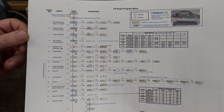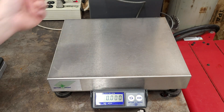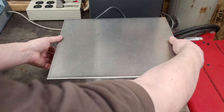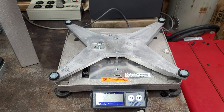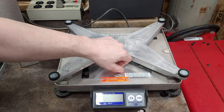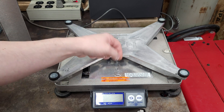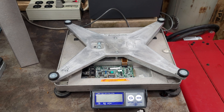We're going to reprogram this per the instructions. First, we're going to unplug it, remove the top, grab a 9/32 or 7mm socket, remove that screw, and remove this cover plate. Now we have access to the main board. I purchased this scale secondhand with a broken USB port and replaced it — it's been working for a couple years with no problems. Let's zoom in here.